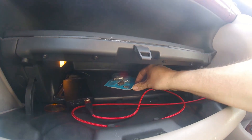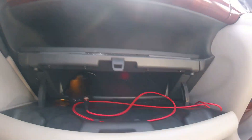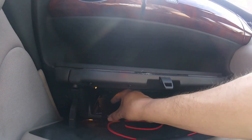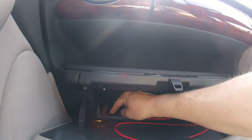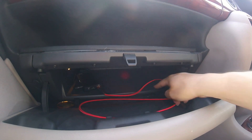That gives us access to all the wiring behind there. If the cruise control wiring is fitted, it's usually taped up in a little bundle. I'm going to need a short torx to get under there — the torx screws are under there, I can actually feel them. They're torx, or star drive, whatever you want to call it. And these are just normal Phillips.